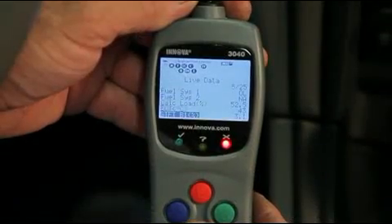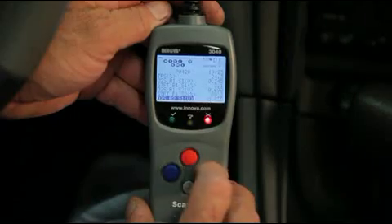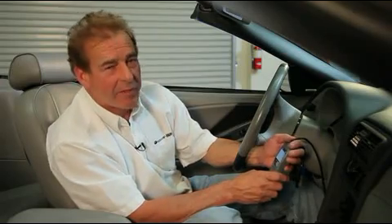So the code appeared and it's going to give me a picture of what was going on at that particular moment. What we can do is scroll our freeze frame and look for something that's out of place. Here's one that tells me we were actually going at an RPM of 1822, so this means the vehicle wasn't actually idling — we were actually driving. Now that we've looked at our freeze frame data, let's go ahead and look at our live data. The difference is freeze frame is like a snapshot; live data is like a video — we're looking at exactly what's going on with our vehicle while it's running. It's so easy: you just push the green button and live data comes up. What's nice about live data is we can go back after our repair and check it to see if our numbers improved. If our service engine light goes off, we've definitely made the right repair.